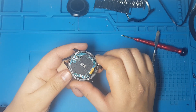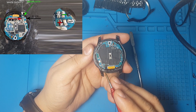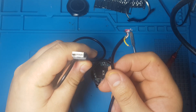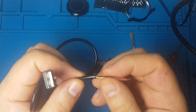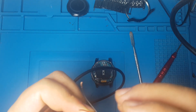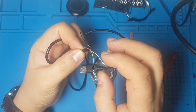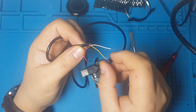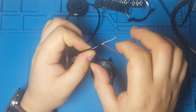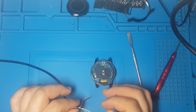So this is the watch. Look at the diagram — we need to solder four wires here. Just find a USB cable, one side is male, the other side cut it and you get four wires. So black is negative, red is positive, and white and mostly yellow or green. White is white. But I noticed today they changed it and some of the wires are yellow. Anyway, look at the diagram and use the diagram to solder these wires here and after that you will be okay.